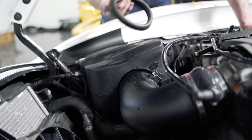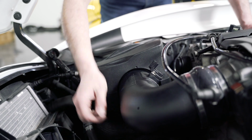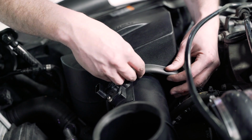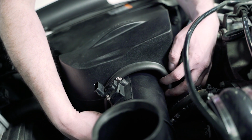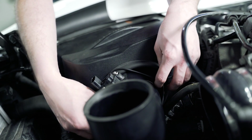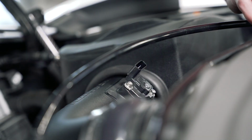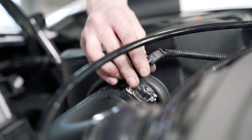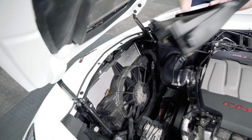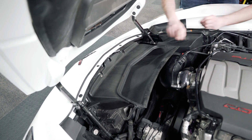Don't forget, like we did, this piece of foam seal will actually be stuck to the face of the box around here. So I'm going to disconnect this really quick and get that slid together and installed. And then we're going to slide the O-ring up and over this. And then it goes in the groove here on the seal. Now we've got to plug the mass airflow sensor back in. Make sure it clips, reinstall the safety clip, and then reinstall the air guide. And put the 4 screws back in it.